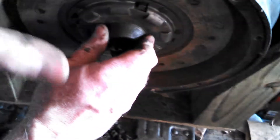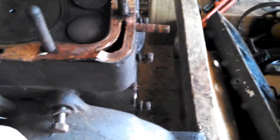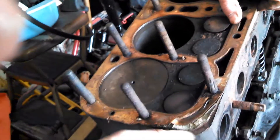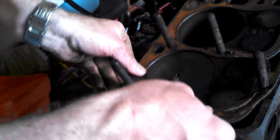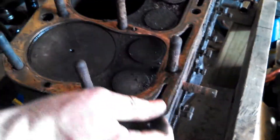So we talked about your intake and exhaust valves, and this is actually the seal - the head gasket. It's a piece of copper with a piece of fiber in between with another piece of copper. I can't take it off because the studs are in the way, so I'll have to work it off in a little bit.